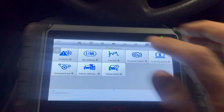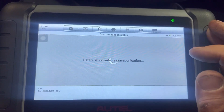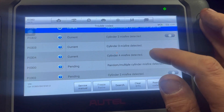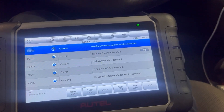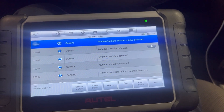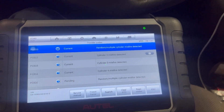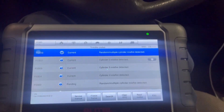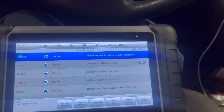I got four codes. Let's look at the DTCs. Random misfire on cylinders two, three, and four. Looking at that, this patient may have some bad spark plug tube seals. The first thing I'm going to do is pull out one of the coils and see if it's coated with oil. If it's coated with oil real bad, that'll cause it to run like this — liquid and electricity does not mix. I doubt if all those coils are bad.